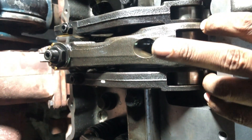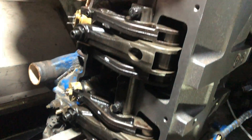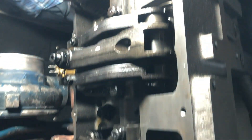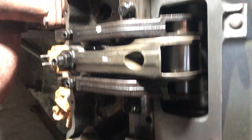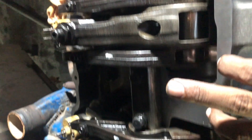In the second rotation — rotating the engine 360 degrees — we will adjust injectors 1, 2, and 4. So number 1, number 2, and number 4 will be adjusted in the second round. I am telling you the sequence of the adjustment according to the manual. You have to do the same, as it is the manufacturer's recommendation.